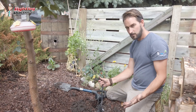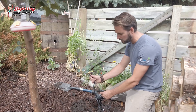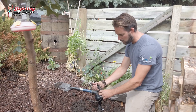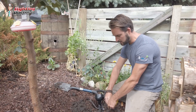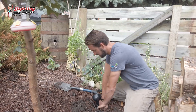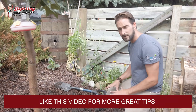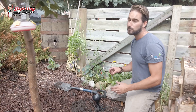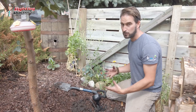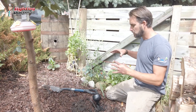That's basically how you wire your lights in line — daisy chain them, whatever makes your life easier. Wrap up all your wires, throw a zip tie or tape around them, stuff them down, and leave it as is. Move on to your next light. Don't bury anything yet because you want to test everything first before making it permanent — if you made a mistake, you want to be able to access it easily.